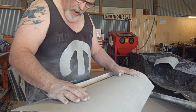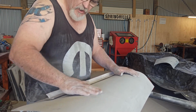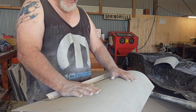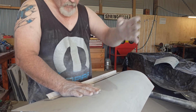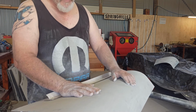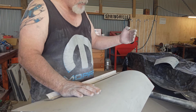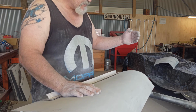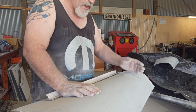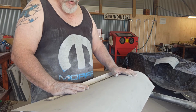But yeah, don't get down and you've got this one little mark, don't get tempted to just rub that one out, because that's when you get these really nice looking cars, and all of a sudden it's halfway down the panel, and you get round to the other side and there's another 2 or 3 spots like that. It's a really nice paint job, really flat, but when you look down the sides of the car, you can see these ripples, and that's probably what they've done.